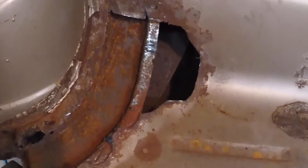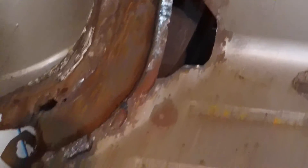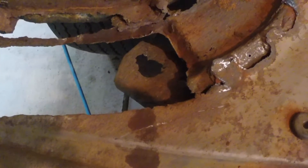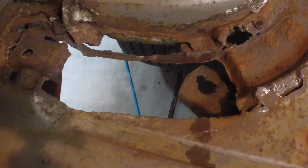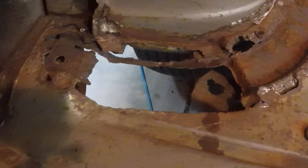I'm going to look at that hose closely before I do some hacking out the rust. You can see that's the chassis in there. So where the body mount was on the frame, I'm going to have to weld a little piece of steel in there. That's the body mount — nothing wrong with the body mount itself. I'll weld that up, get that piece in there, and we'll call it good. It's looking good.